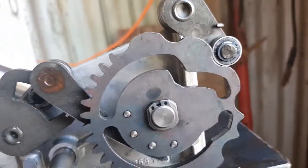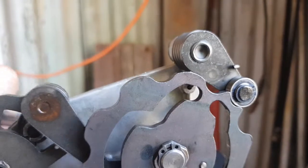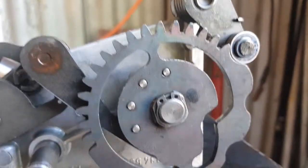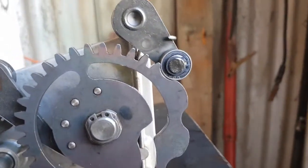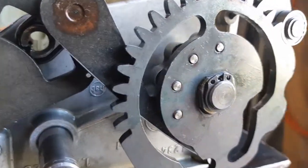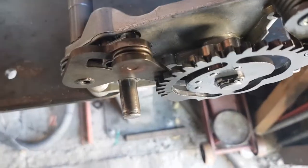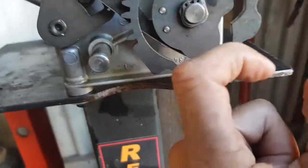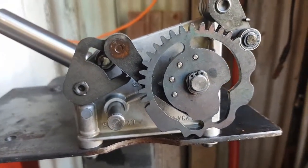Here's the little shift wheel — this is currently sitting in third gear. If I lift it up now: that's first, neutral, second, third, fourth, fifth. That sprung wheel keeps tension on the gear cams and makes sure they can't flop around. It's got a very strong spring on it, and I replaced them with a little roller ball race which is now readily available. This little spring that breaks everywhere and causes all this grief — that's the one that snaps and then allows the shift pawl lever, which has teeth that grab these pins and move that wheel backwards and forwards, to fall out of engagement. Your bike is then stuck in whatever gear you're in at the time.